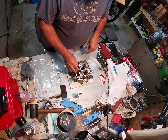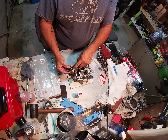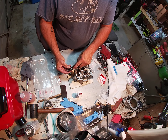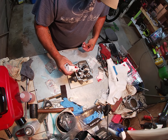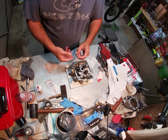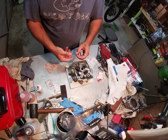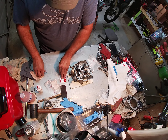I kind of try to clean that paint off a little bit just because I don't want it in the motor. I already got my retainer on there from earlier. The tight coil always goes to the bottom. Take your top retainer — I like to put a little bit of assembly lube on here too, just for break-in. Once it's settled in, regular motor oil will take over and get rid of this stuff.